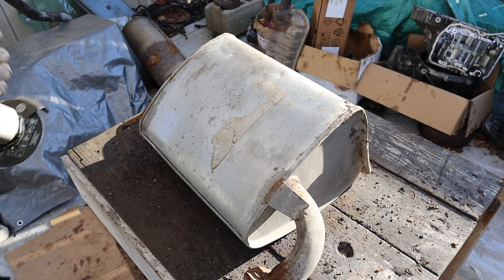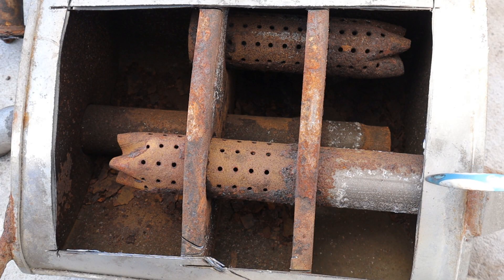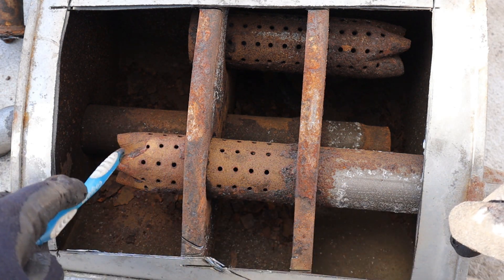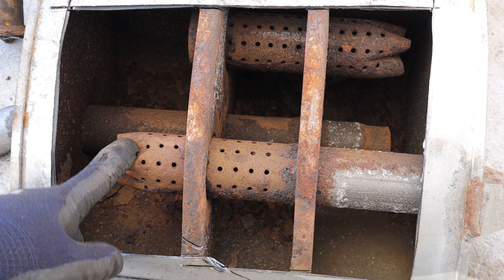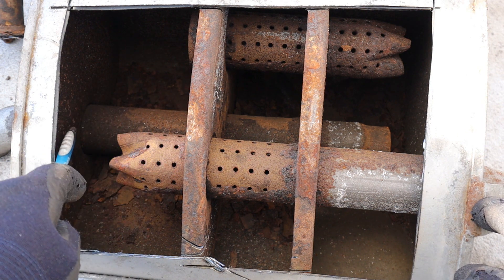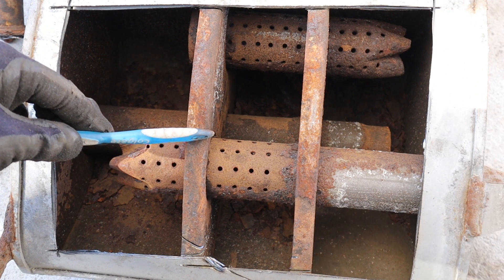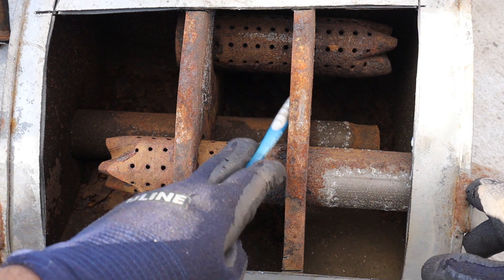Next up we've got the aftermarket version of the same muffler with a bit of a different layout inside. The input gases come in through the first chamber and then into the second chamber through these perforations, so some of the fluid ends up in this middle chamber. The exhaust gases exit out the back through this pinched pipe — it's not completely locked up, exhaust gases can still come through. However, there is no glass pack at the back like there was in the OEM. Exhaust gases and the perforations fill up the rear chamber where the wavelengths cancel each other out moving between the two baffles. Unlike the OEM, once this baffle is filled up, the exhaust gases go through this pipe back to the next chamber, as opposed to holes in the baffle. This middle chamber allows for additional noise cancellation with yet another two baffles canceling each other out.